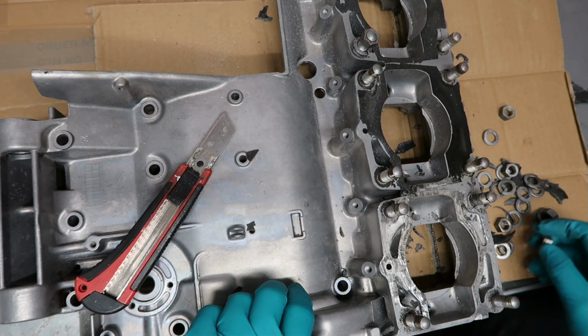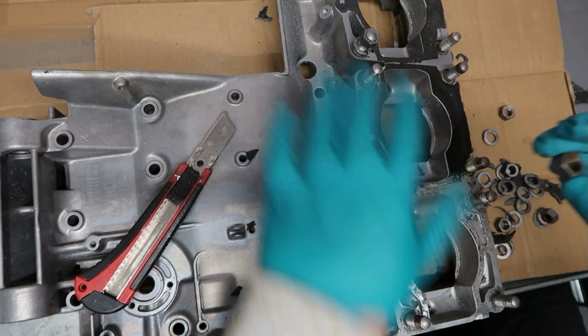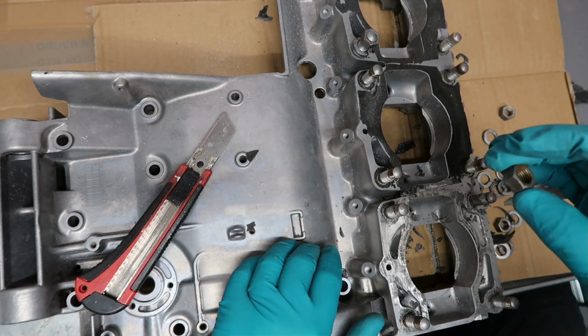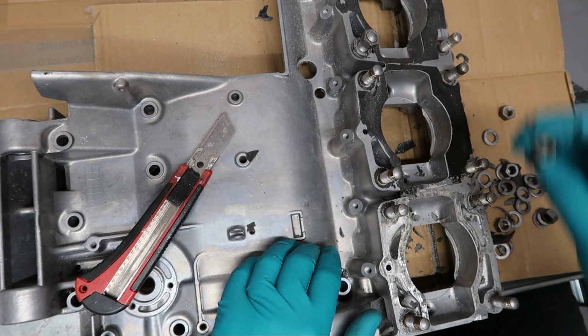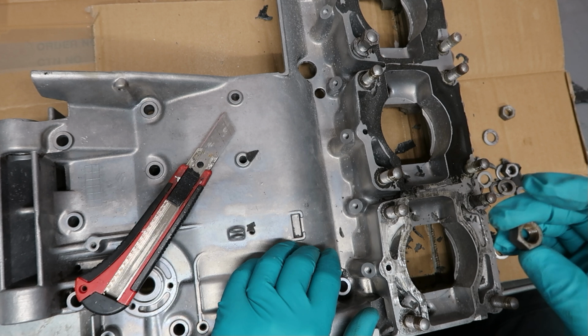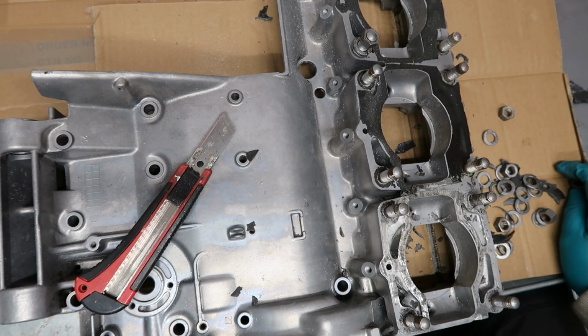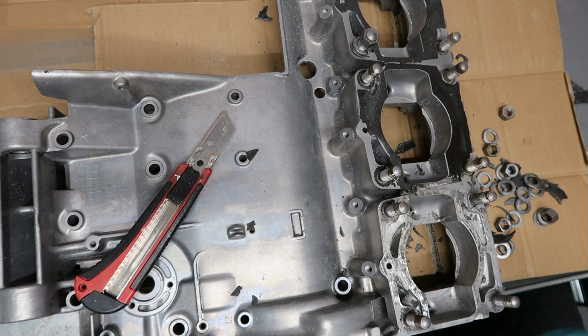So a quick FYI, that's why when you tighten big engine bolts, what you do is a 3-stage process typically. So first stage you go all the way around about 50-60% of the torque, then you go to 100% of the torque, and then you go round again for 100% of the torque, and the last time you go round is actually to lock the nut, right? That's what it's for. I've been on or joined a ship where the lad who changed the piston didn't do the third set of retentions at 100% because he didn't see the point, and unfortunately the thing let go after probably about 100 running hours or something like that and wrecked the crankshaft. So that's why you do it.